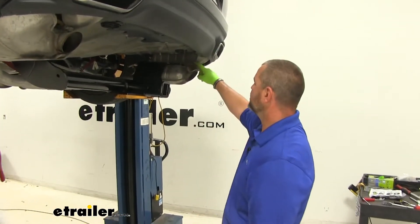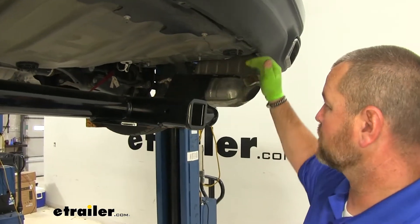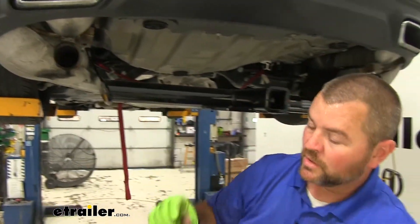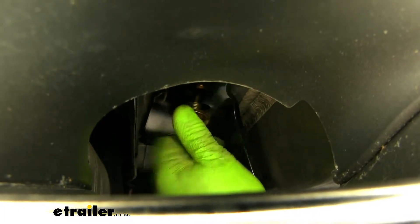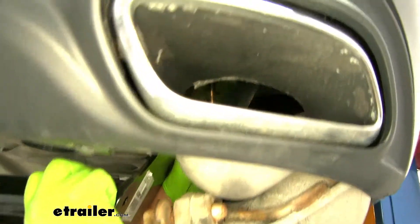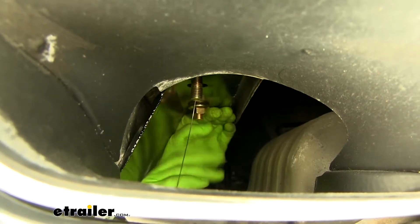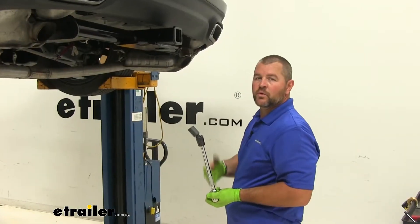To get your hitch up in place, you're going to have to go in at an angle. You can see how I pulled down this hanger here — push in that corner and you can slide this in. I've got it resting right on top of my exhaust. Now we're going to take our pull wires and go through the corresponding holes in the hitch. On the driver's side, because I have one bolt going up, it's going to be a hex bolt — you're going to put a conical tooth washer on it with the teeth facing up towards the hitch. Once we get our bolt in on one side, we'll go to the other side, move one of the pull wires, and put on the nut. With one on each side and our hitch held in place, we can install our remaining hardware.